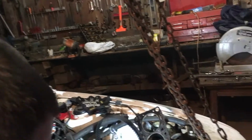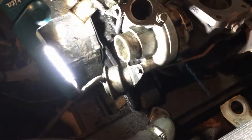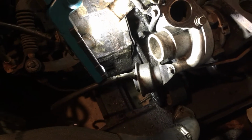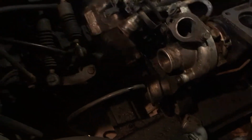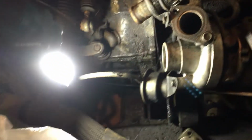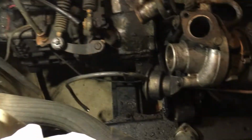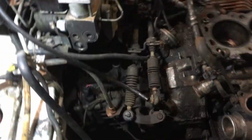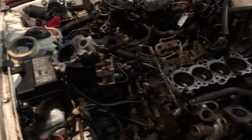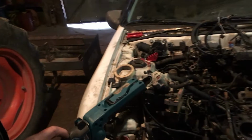So it dulls them. It dulls them, right. But it's not bad, it's just a little bit. It's not real bad. But usually on those diesel trucks, you'll see those impeller blades worn down to nothing. And it's all because they just didn't change the air filter. That's easy to get out.